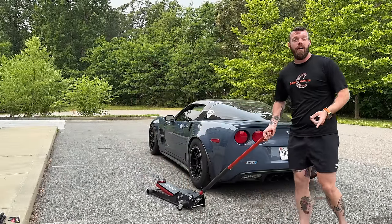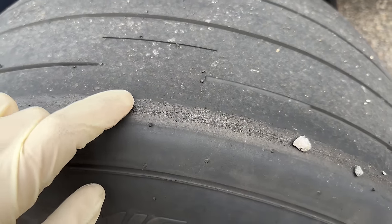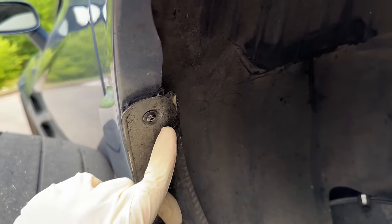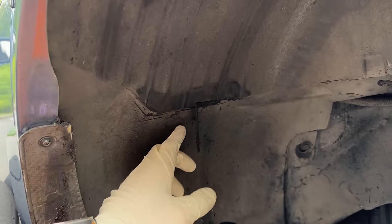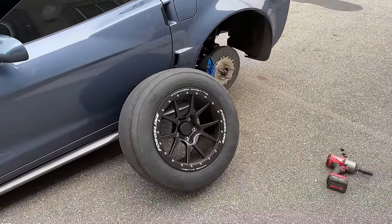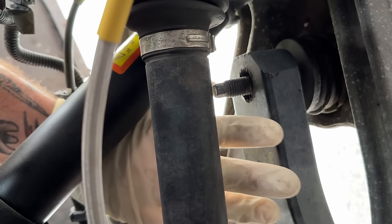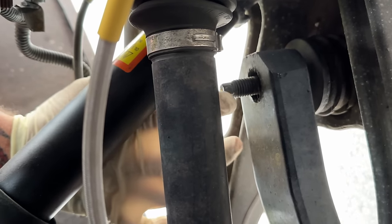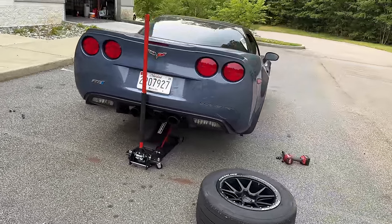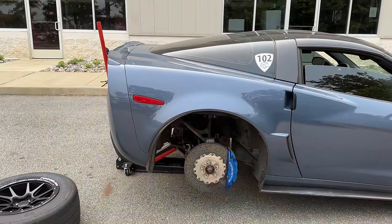We'll take this opportunity to work on the car outside. Given that we've driven on it a little bit since we made that hit, it doesn't look that bad — but when it first happened, it was nasty. You can see exactly where it was rubbing. Not only that, but the car is so low and the tires are so tall that it was rubbing the fender liner itself. On the old tires we could get away with this sick, nasty stance, but now that we have some real sticky tall tires on there, it's clear we have to raise it up. On a functional, normal ZR1, it'll take about two minutes — we just have to spin that bolt to raise the car up. Unfortunately, on my not-so-normal ZR1, those bolts are so blown out the bottoms can't twist anymore.